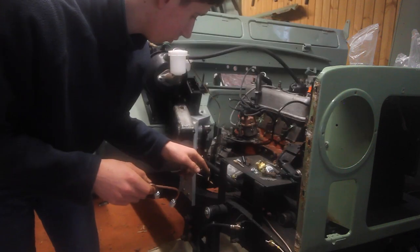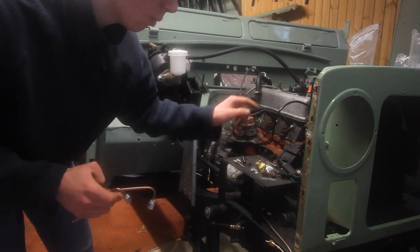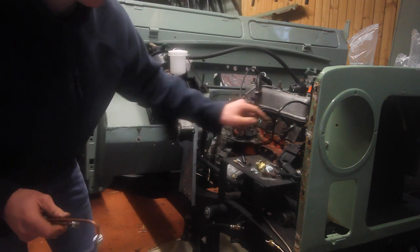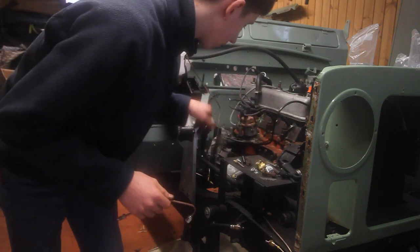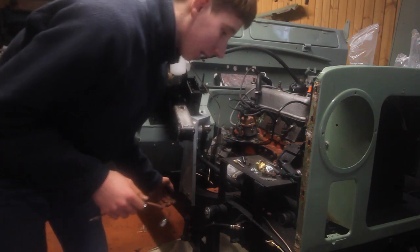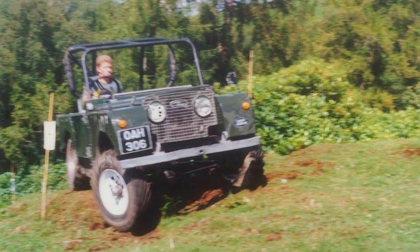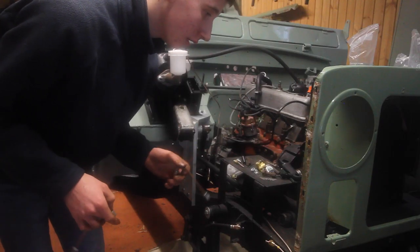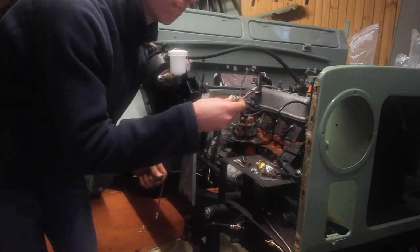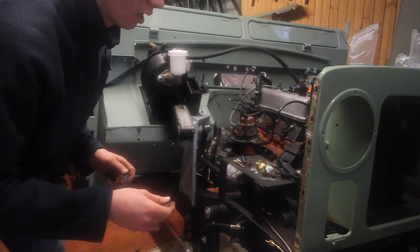I've got to do the one from the union to the front left, which I'm going to try and go under the radiator panel. Standard goes on the flywheel crossmember, but that seems a little low. Dad said when he was trialling his 80 at my age, he once whacked the flywheel crossmember up and in which case - no brakes. Dad's 80 goes right the way to the crossmember further back, but I'm going to go forwards and take the radiator panel off.